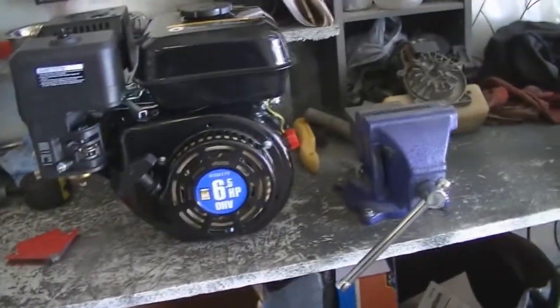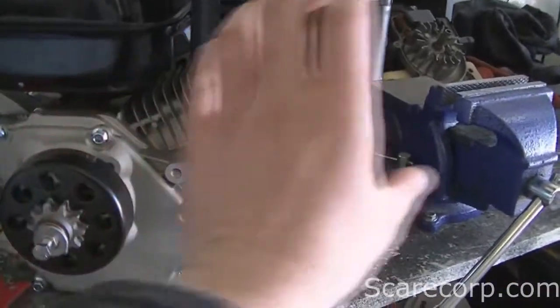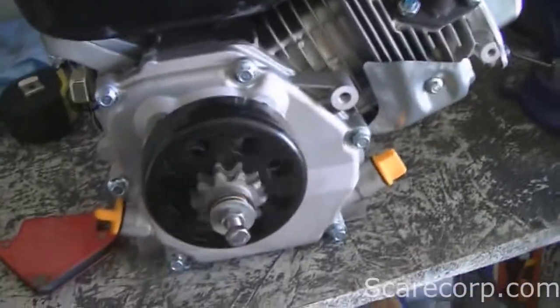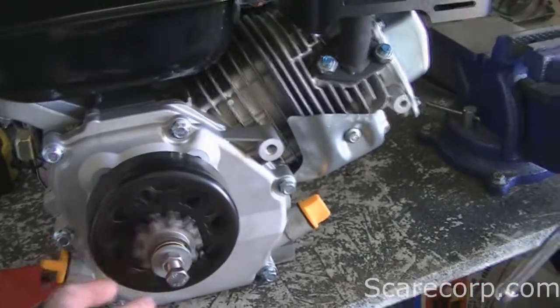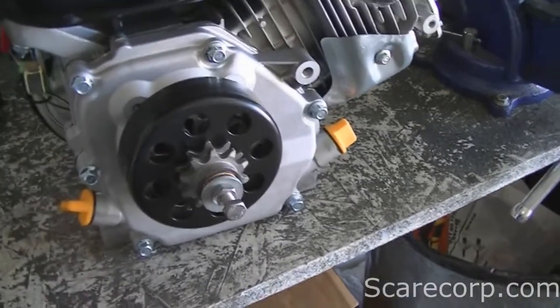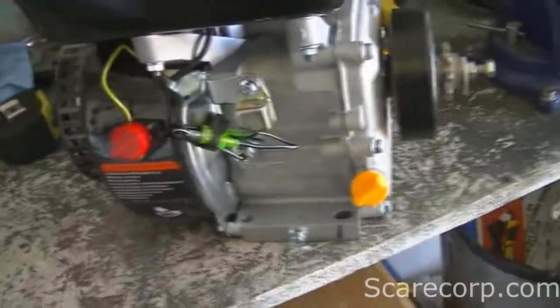Here's my motor — I went with the Honda clone six-and-a-half horsepower, gives you around 200cc's, so it's a pretty nice motor. The nice thing about it is that it's a 45-degree angle piston, so these ones are supposed to be a lot nicer with a centrifugal clutch. I went with a 10-tooth sprocket because I want to gear it down more for torque and less for speed, so the kids won't kill themselves on this thing. It's a pull start, not an electric start, and it's got a nice on/off switch which I'll more than likely be transferring to the handlebars.